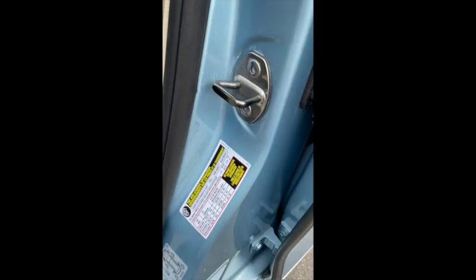Now that you know you're probably going to replace these tires, the next question is: what size do I need? You can look at the tires on your vehicle now, but that may or may not be a good way to do it — sometimes someone puts tires on a vehicle that aren't exactly to spec. To be sure, open the driver's side door and look down on the door frame. Right here there's a sticker, and that sticker will show you what size tire is correct for your vehicle.